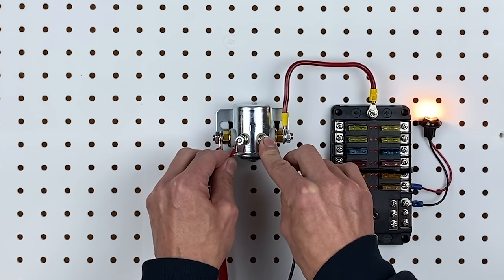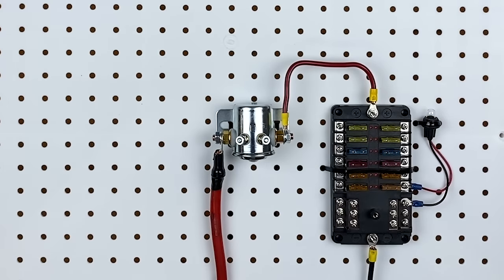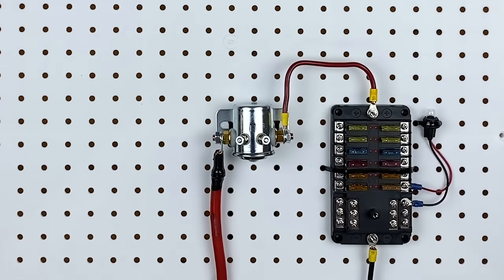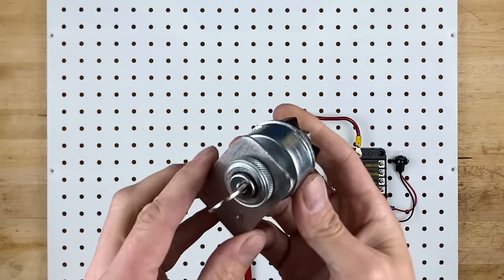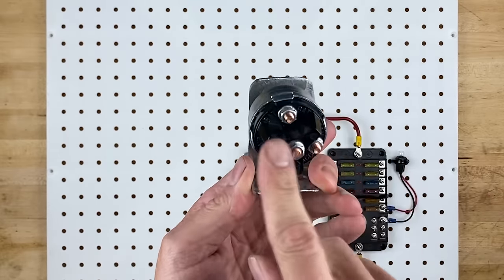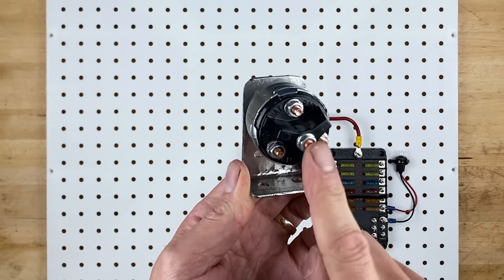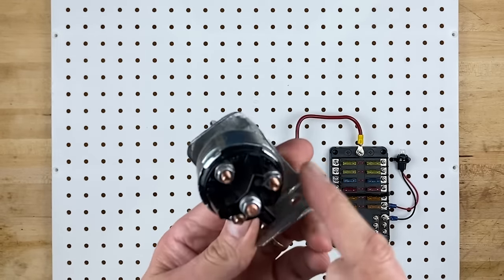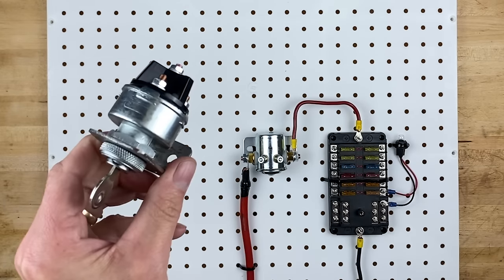I could install this on my car and hold jumper wires on the solenoid under my hood, but that's kind of inconvenient. So what I'm going to do next is hook up an ignition switch that will then turn on the solenoid which will then power up the fuse box. This right here is the most basic of ignition switches — I just bought the cheapest one available, but a lot of them are wired exactly like this. You can just buy different levels of niceness. This one has four different terminals on the back: a battery input, accessories, ignition, and start. We're going to have a wire connecting to the BAT because that's power going into the switch, and then a wire coming out of the accessory going to our solenoid. Let's mount this to the board and hook up a wire or two.